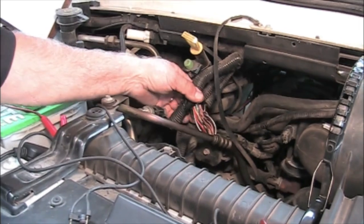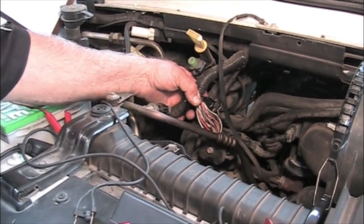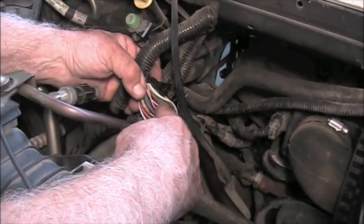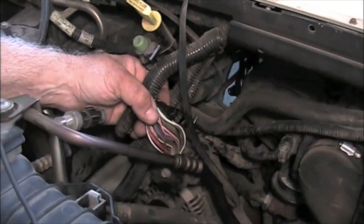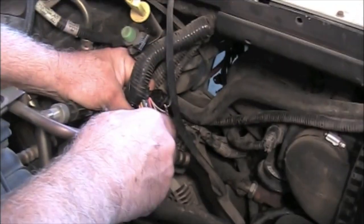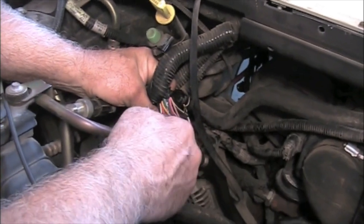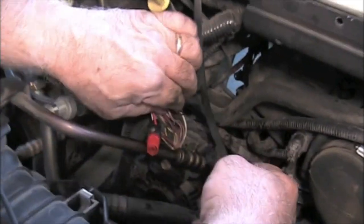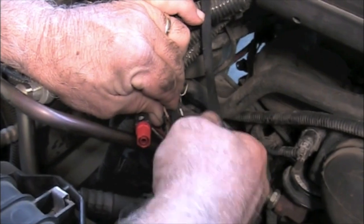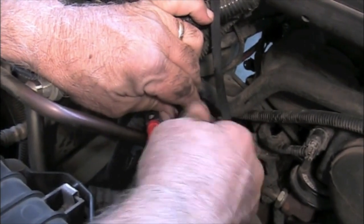I follow the harness back and come right in here — this is where all the fuel injector wires are. You can see the red wire and all the appropriate injector wires. I need the red wire and the tan wire, so I'm going to tap into the red wire and into the tan wire. There are different styles of NOID lights; I like this one because it has a light with a suction cup and a probe I can get into tight spots.